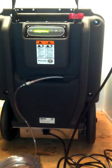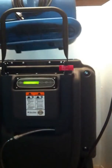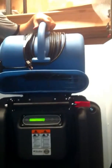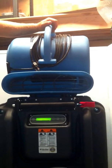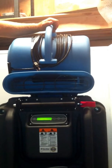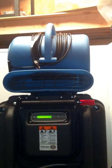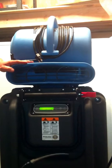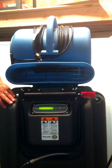The machine should really be used in tandem with a couple of fans. When you're looking to dehumidify a room or take moisture out, you want to get the moisture to circulate — or the dry air to circulate with the moist air, or have contact with moist environments — so that the moisture collects in the air and is then pulled out by the machine. So when running the machine, you want to run multiple fans to maintain the highest level of humidity in the air, so this machine works at its highest level of efficiency.